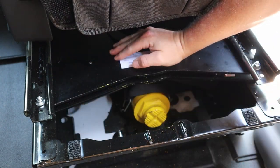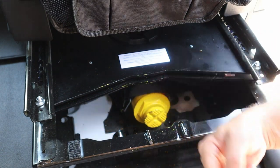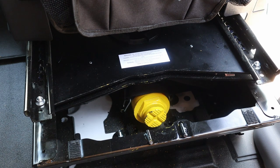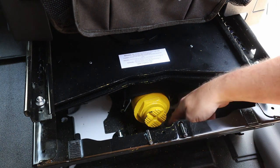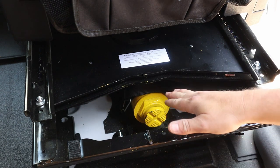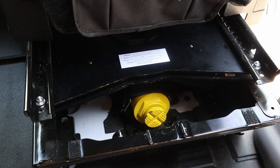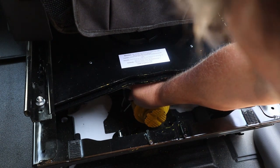Typically the cylinder of the jack will be faced toward the interior of the van, because there's a little holder there — a little rubber stopper it sits in nicely. At the other end there's a square base, so make sure it's positioned like that when you put your jack in. To get it out, first there's a strap, so we'll apply some pressure and remove the strap.